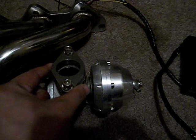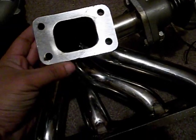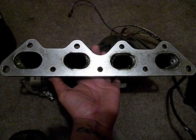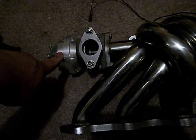Never been crushed. Looks pretty much like a 30 millimeter wastegate T3 flange. Looks like it's never had anything mounted on it — it's pretty clean, not scarred up or anything. Not sure exactly what model this will fit. I'm not a big Honda guy, but looks like a 1.8 liter. It's really clean, looks like it's never been mounted. I actually checked the wastegate and it's opening up at about 8.5 psi, so that's good for a stock engine without having to change anything out.